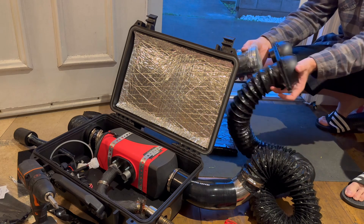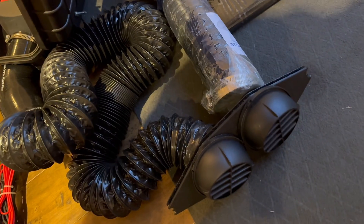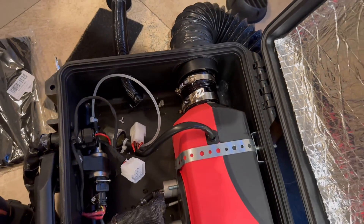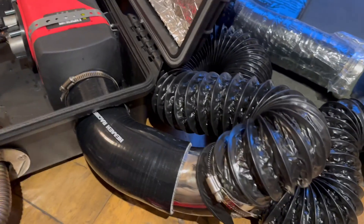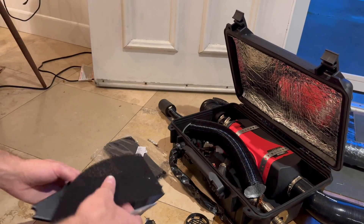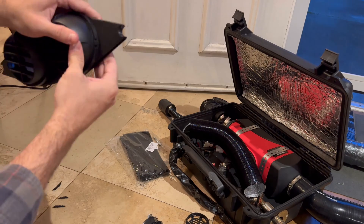What I'm doing here is using the dual outlet from BC Off-Road Shop, which allows me to draw air in from the already heated tent into the unit. The heating occurs in the unit, and on the outlet side it's the already heated air plus the extra heat the diesel heater produces, so I can run the unit on a lower setting and save energy. While I'm putting this together, I'm also adding a bit of filtration using activated carbon sponge filters from Amazon, cut to size and sandwiched into the outlet housings.